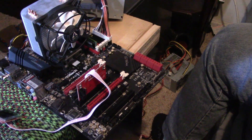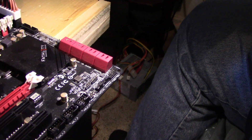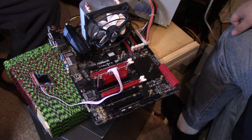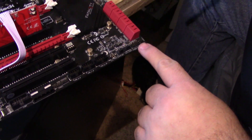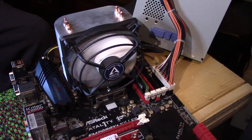This is a way to power on a motherboard if you don't have a power switch — it's not the recommended way but it's what we're going to do. If you look carefully, you can see all the connectors, and these two pins right here at the end are the power switch. Since this board is outside of the case we don't have a button readily available. What you do is just short those two pins together.